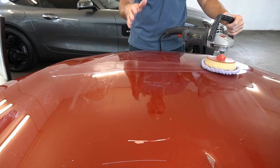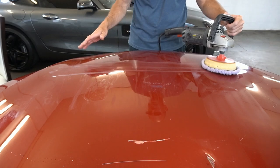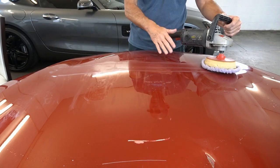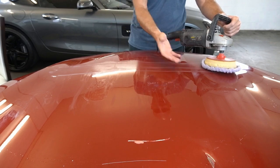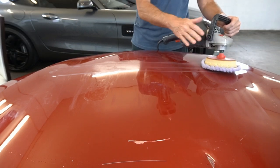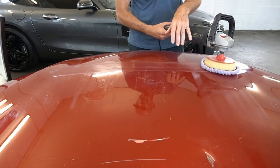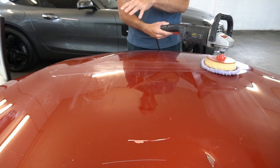Both polishers between the 3rd and the 4th speed setting, pressure equal to a firm handshake, correction speed down, correction speed back. We'll check and see what the cycle time is. Does it dry out quickly? It'll happen more with a wool pad because of the airflow through it than it would a microfiber or foam pad. But we'll check for dusting and all of its characteristics on top of its ability to correct sand marks.